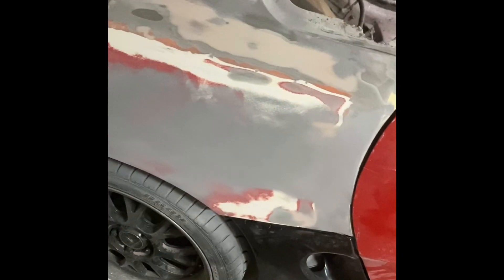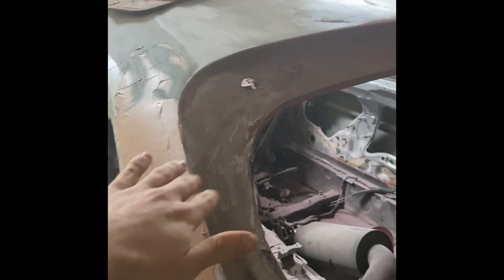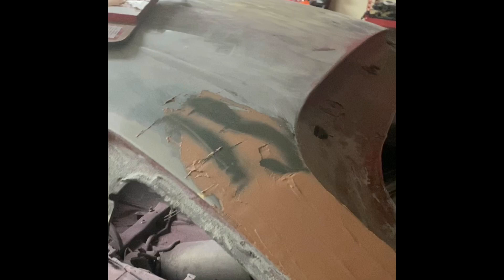That's going to be a wrap for tonight. I went ahead and put some bondo on here, letting that dry — filled in a low spot that was there. I welded in a patch panel, you can kind of see it right down there, so that hole's not there anymore. I laid some bondo over here as well to fill in that spot I cut out and replaced. That's all nice and new — you can see there's a panel in there. I still need to blend all this, and I went ahead and laid some fiberglass on it to blend it all back in.